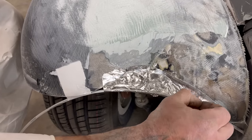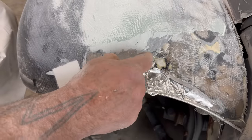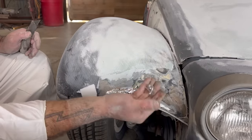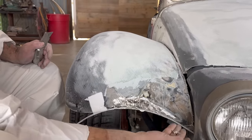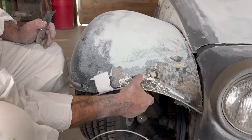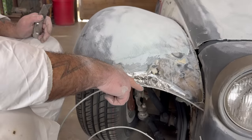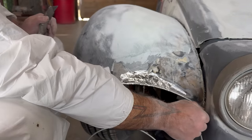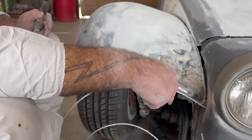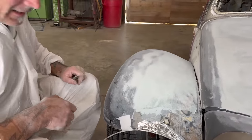Again, the backside of this entire project will be finished. So what you're seeing here is a really raw, deep, cavernous shape that will get sanded back from the inside and finished. So this is just, again, the prototype that I mentioned in other videos. It's just to get something to work with. This is a pretty small area, so I'm not even going to use the fiberglass resin that we've been using. I'm going to mix up kitty hair and laminate it in with fiberglass mat. So this is going to be way strong with solids. And I'll do that right now on the palette.